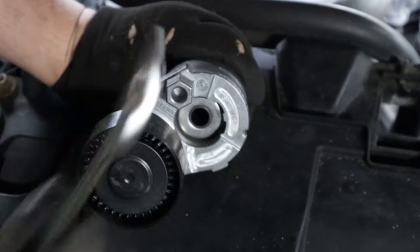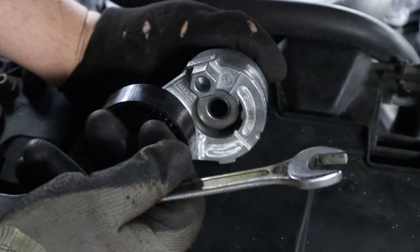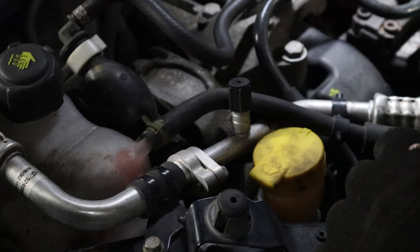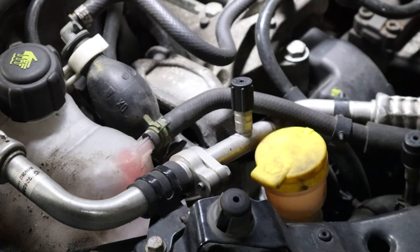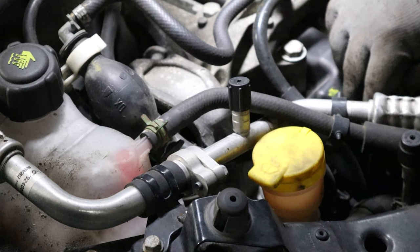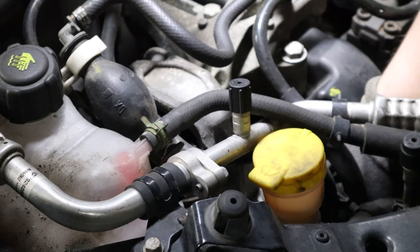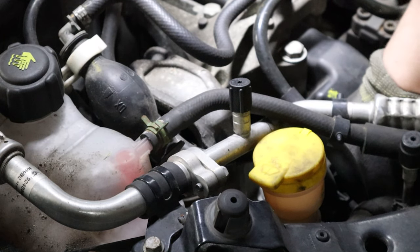After that we can just let the tensioner go. There is a bolt here in the middle — we have to undo that bolt and then we can take the whole thing off. Putting it back is of course the same process. I really want to show you everything but to be honest there is just not enough room to get a camera in there. I maybe even have some light regrets doing it this way instead of dropping the whole thing. And that's why you want some long spanners, because I'm still not able to tension the whole thing — there's definitely not much room. I remember it was easier to get it from below, so let's try that. If that's going to be a pain I'm definitely going to drop the engine.